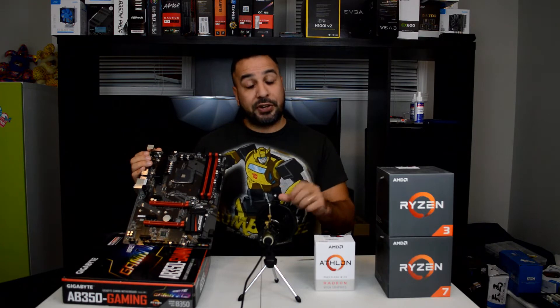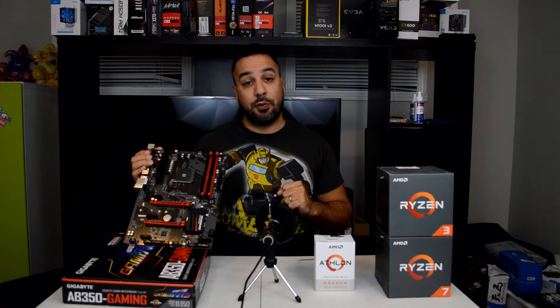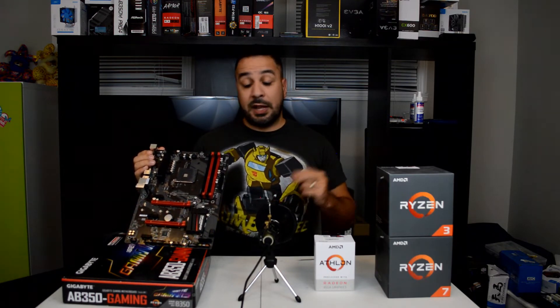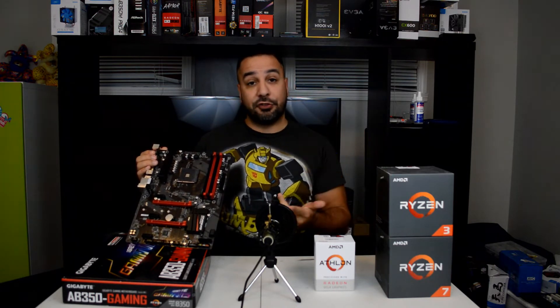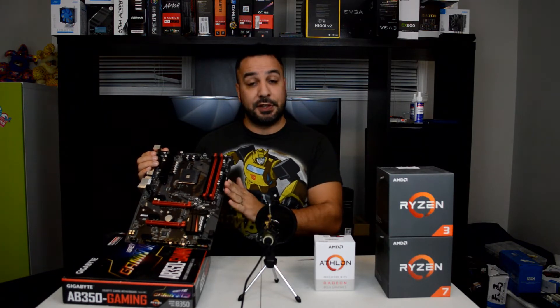As long as you get a board with a decent VRM to make sure you can overclock the CPU you're aiming for — but that's more precise than I want to go into in this video. You can check out reviews for individual motherboards on different channels once you know which chipset you're going for. So to recap: A320, most of you can forget. Most of you will be in B350 and B450. And if you're aiming for eventually having a multi-GPU setup, then it might be worth going straight to an X370 or X470 motherboard.